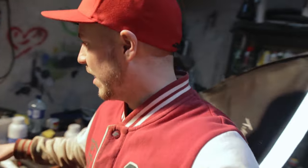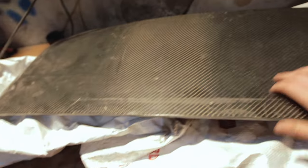So what I'm going to do with that is I'm just going to go ahead and sand the whole thing down, use probably 300 grit sandpaper, and then that will get rid of all the scuffs up here. And then once it's sanded, I'm going to re-epoxy it all, and I'll epoxy all the little splits, so wherever it has split, it becomes one piece again.